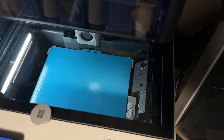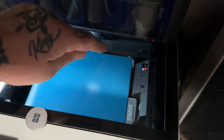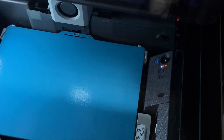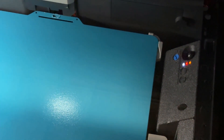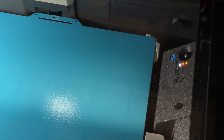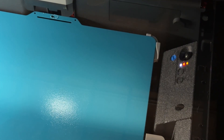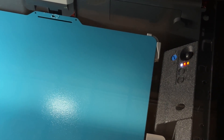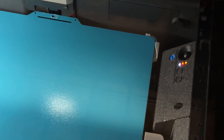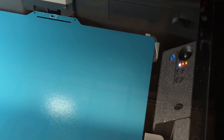I've been doing a little test here, seeing what they heat up. I put them on 45. I'm just learning about the positioning of the switch — the little blue button. There are three different positions: one's for 40, one's for 45, and one's for 60. I've got it on 45 because that's kind of the average I'd be using. This is a cold room and we've been testing on manual mode — there are two positions, auto and manual. We're finding that it's holding 45 degrees no problem. It's actually heating the whole room.